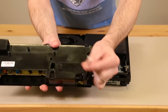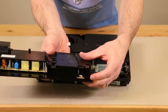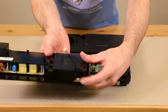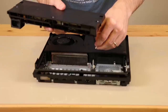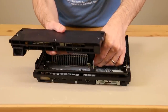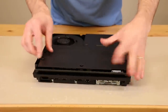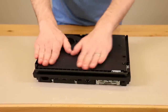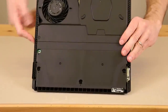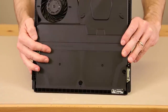Your power supply may or may not come with this cable. If it doesn't come with it, you need to take it off your old one and install it onto your new one. Plug it in and make sure that it's tucked around this little clip right here. Put the wires down first, plug them into that connector, then line up your power supply and wiggle it as it goes down. Push down on all the sides until it sits in there neatly just like that.